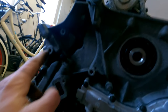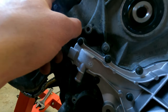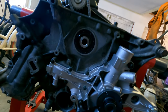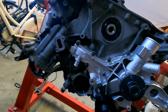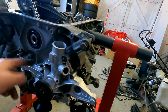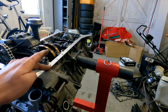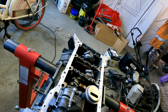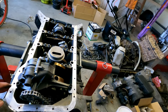And then you have these two bolts. These two are for the tensioner, also M8. And then the rest we'll see where they are from. So that's it. I put a new seal in here, also done. I got the extra gasket that's over here off while it's still wet, so you don't have the possibility that you pull the gasket out of the sealed area.